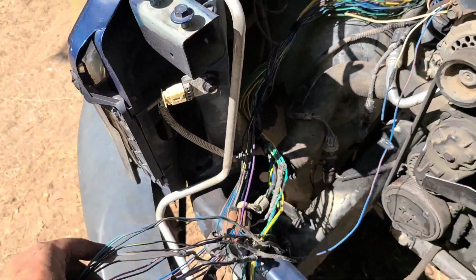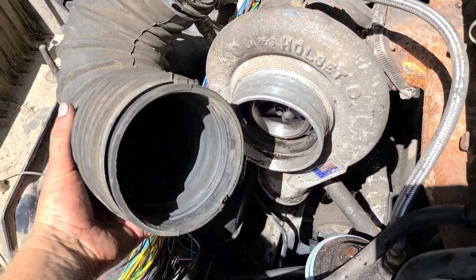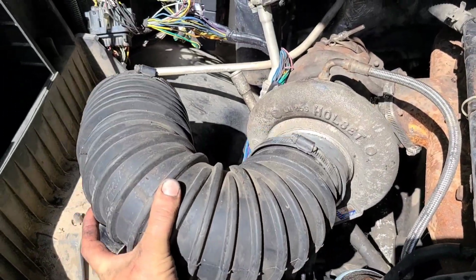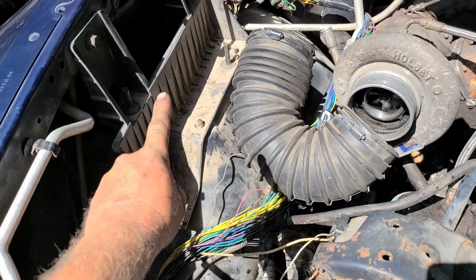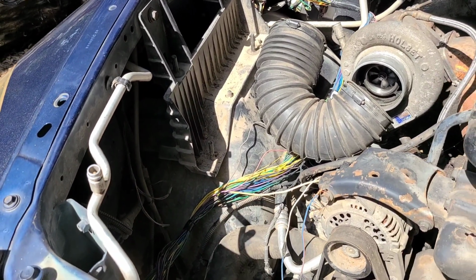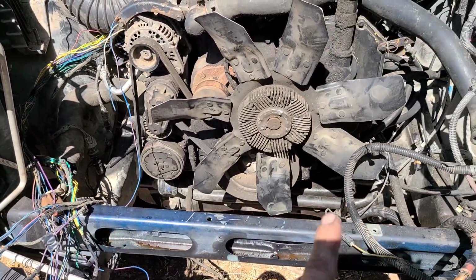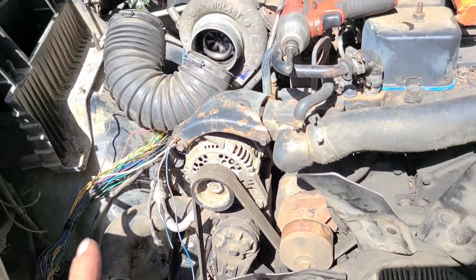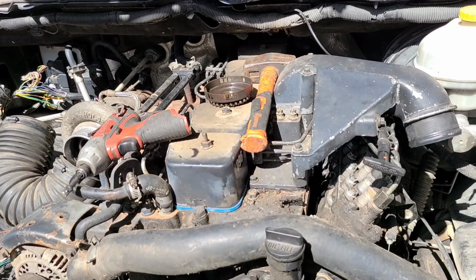I've modified the wiring harness, so I've got it so it'll turn over. I'm gonna mount this and then put it just like a pod filter there. That'll be easier. Thinking of mounting another battery maybe here. I'm gonna wait and see when the intercooler piping and everything, and radiator, condenser, we're gonna have factory AC. Bought all factory third gen Dodge AC stuff, so that should work.